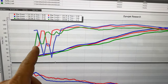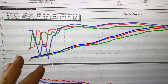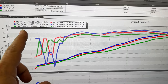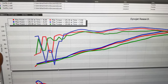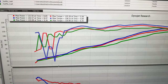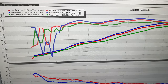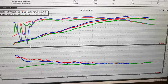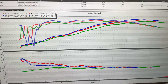It looks like on all three runs there was a breakup in the ignition at low RPM, so I definitely need to replace all the wires, the cap, and the rotor. But if we look at the power, our run where the temperature was in the middle of the scale was our highest at 126 horsepower — that's exactly what we want to see. The horsepower came down a little bit on that last run where it was really, really hot. I'm not getting the car to have any problems like it did at the rallycross, but I have not run this car on the dyno before. So I'm going to replace all those ignition parts and then take it back to rallycross and see if it's fixed.